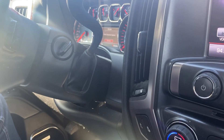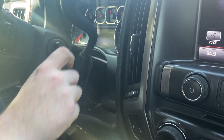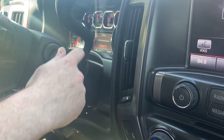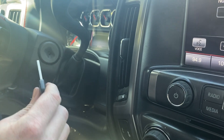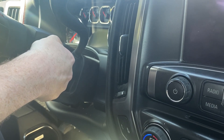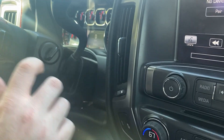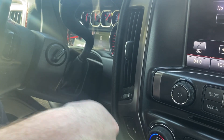Now we've reached our third and final 10-minute mark. So now we're going to turn our key to off, turn it to on, and now our key should be programmed. Let's go ahead, take the key out, and start it to test. You'll notice when you first program in the new key, you almost have to start it for an extra second or two — hold it cranked forward.